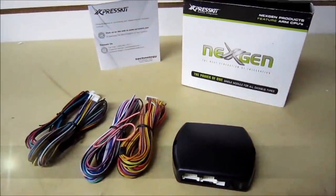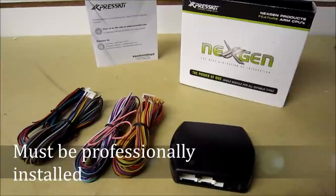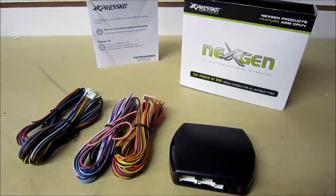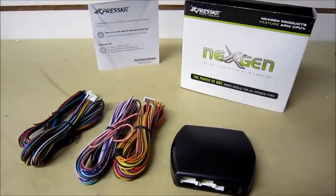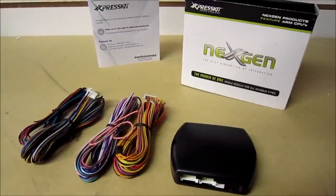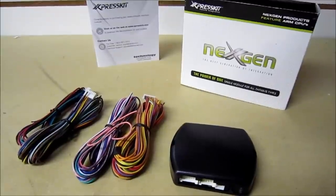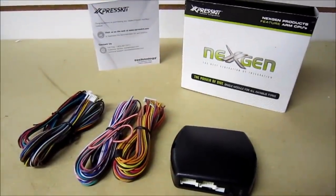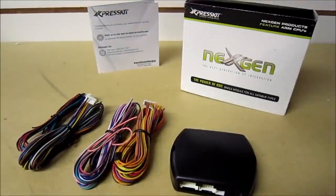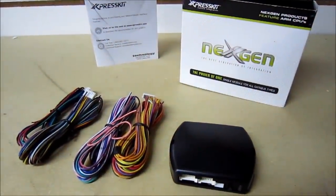I highly recommend that you have a professional shop install this for you. Compared to a remote starter when you're using RSR mode or remote start ready mode, it is less product to install, but there's still a good amount of wiring. T-harnesses are available, but you need a dealer's account to log in to program these, and you'll also need the X-loader to interface between your computer and the module. When dealing with newer vehicles and all these computers, if you're not experienced installing remote starters, you should have a professional shop install it so you have their warranty backing you up.